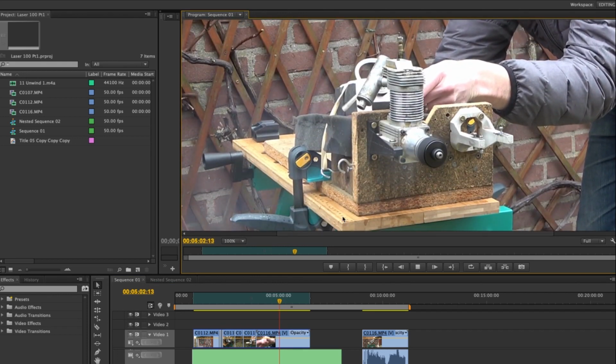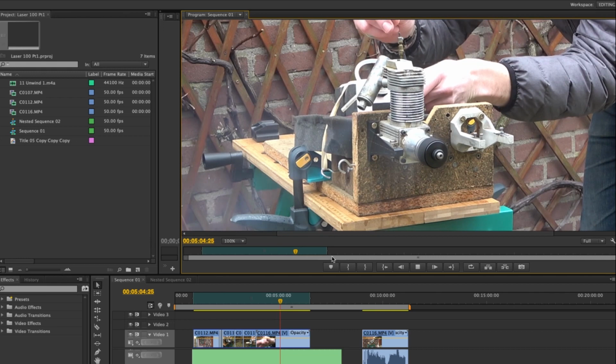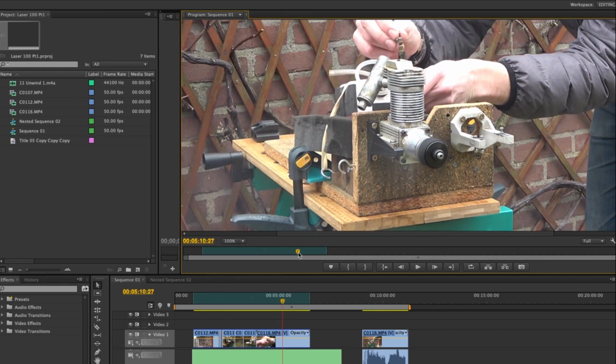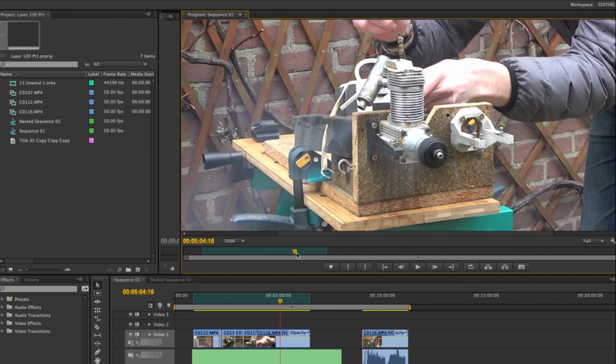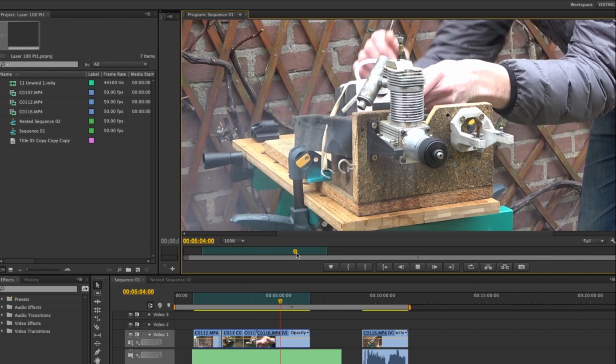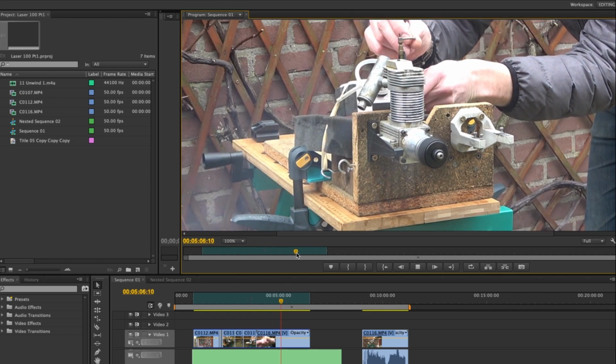Stupid, really, really stupid. Little was I to know. So anyway, we keep going forward. Now what we've got to look out for, I start leaning it, and as I lean it, I felt it didn't really get full, the sound that I'm used to with full RPM on an engine of this size. So you listen here, I'm making it leaner. Smoky.